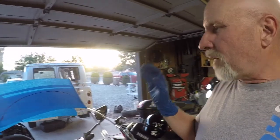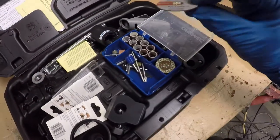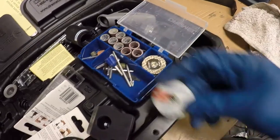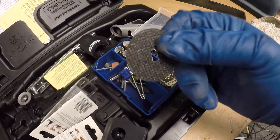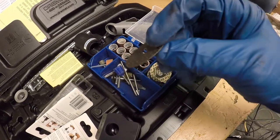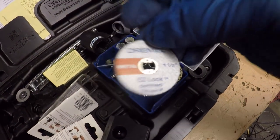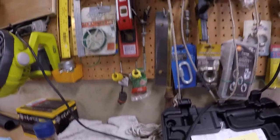This windscreen is rated for about 60 miles an hour max. I've seen a lot of people cut these with jigsaws, but I'm going to try a Dremel tool. I've got a couple of cutting devices but I'll start with this thin metal cutting blade — it's an EZ Lock cutting blade, inch and a half diameter — on my regular Dremel tool. I also have some sandpaper that I'll hit it with after the cut. It might melt the plastic a bit, but we're going to give it a shot.